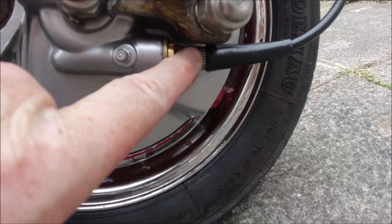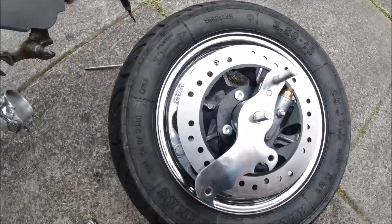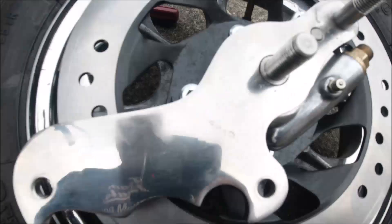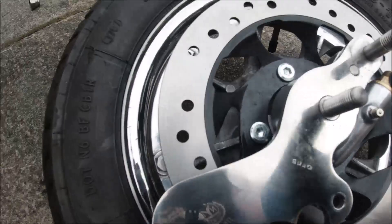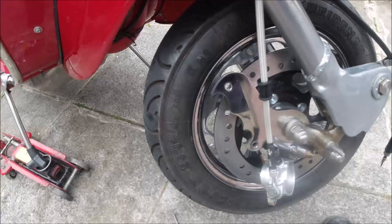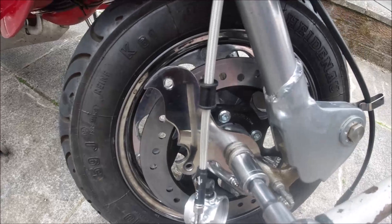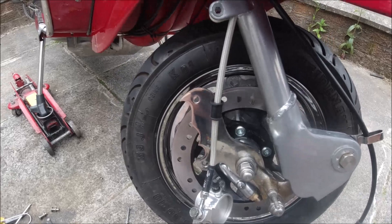The disc is ready. I'll explain this — you'll probably see it better now. I'll show you the difference between the hubs and why I did this. I recommend you do it yourself. These nuts are done up at 40 pounds, just over 40, and the one on the other side is already done. The wheel's in, turning nice.